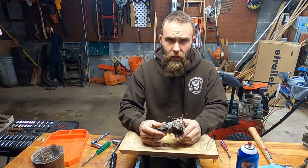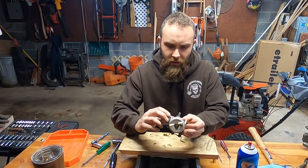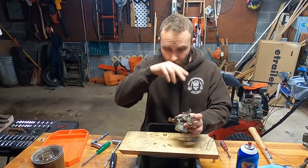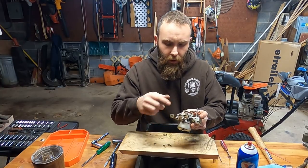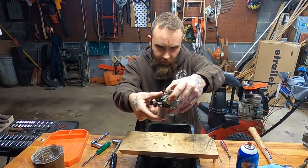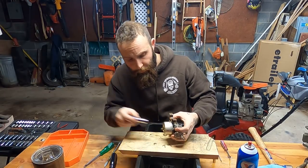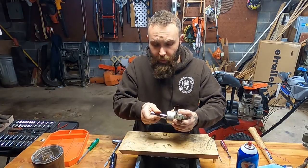What you're looking at here, most of these snowblowers use Tecumseh engines. This is one of the newer ones. It's non-adjustable. On the older ones, which is really nice, the Simplicity over there has it. It's got an adjustable idle mixture and adjustable fuel mixture on the bottom. This doesn't have it. This is a dump valve, so that at the end of the season, you can dump all your gasoline out. And this is actually the main jet right here, built into the bottom bowl nut.